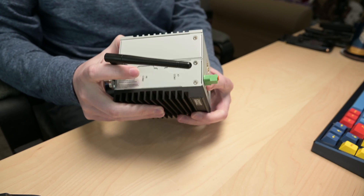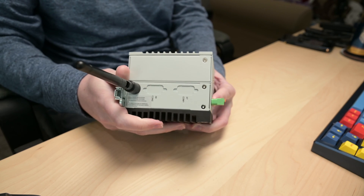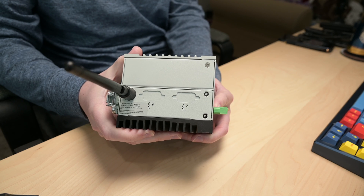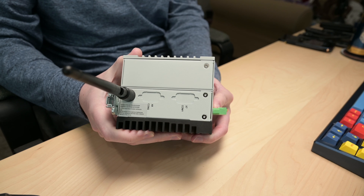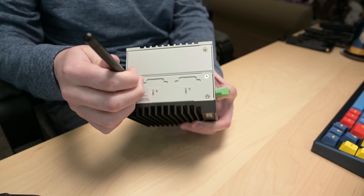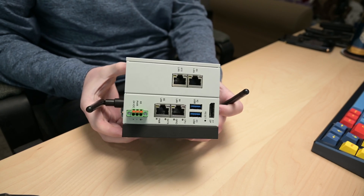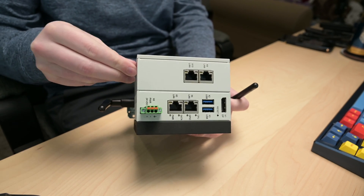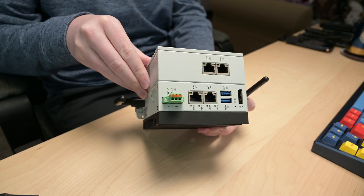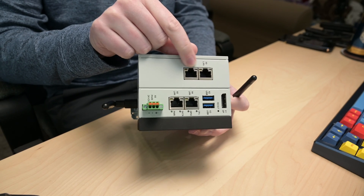On the side here you'll see the cutouts for the COM ports. As I mentioned in the specification portion of this video, I wouldn't go with these unless you have a very specific use case where you know you'll be able to use them — because Niagara is not that use case. We've got the antenna here for Wi-Fi and Bluetooth since we did turn that on for this model. Going back to the main I/O, you'll see this second section of the PC — that's the expansion part. If you order it as I spec'd it out, you won't even have this portion; this is the additional two Ethernet ports.